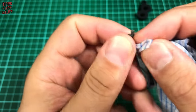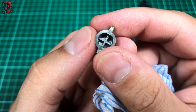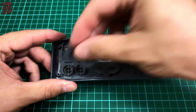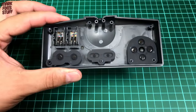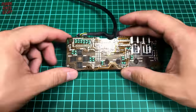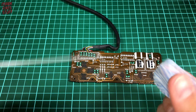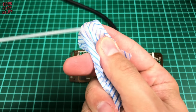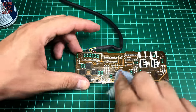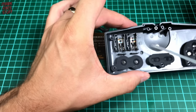You can see there's a little bit of residue still in there which we can clean out with this handy cloth. There we go, dry as a desert gulch. It's really easy to reassemble this controller — none of the buttons do the usual 'I'm going to pop out' thing. So having quickly put the rubbers back in we can turn our attentions to the board. The board is in good shape but we're going to use some contact cleaner and just give it a wipe over. I prefer to spray the contact cleaner onto a cloth — that way you don't get too much overspill. Just wiping over the relevant parts of the board as quick as possible; not too much stuff's coming off but it's good to know that we've actually cleaned it.